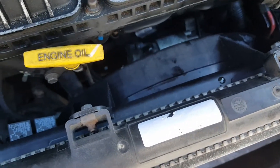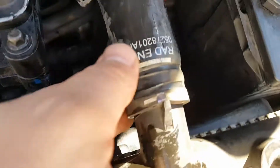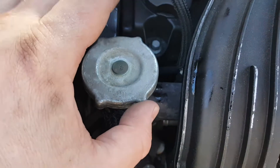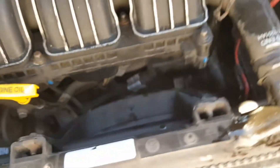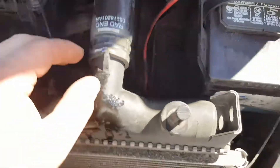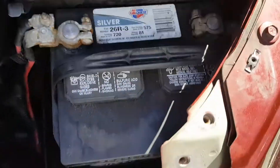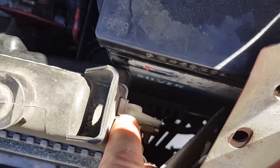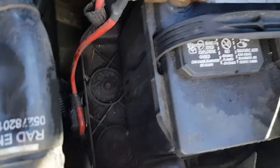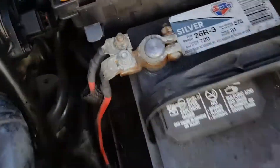I actually took one of these screws from this area here and put it in there, so I now have five working screws on this fan. Something that worked for me to get this in and out — I took out the engine oil dipstick; this was sort of in the way. So when I pulled the radiator back — this is the new cooling fan. Another thing: when you pull the radiator hose out, you want to take the cap off the radiator so it doesn't all ooze out and bubble out. I actually took a turkey baster and dipped a little bit out of the top of this so it wouldn't overflow and leak. You have to take the air filter cover off. I actually found it easier to get to the middle screw from the underside of the car.